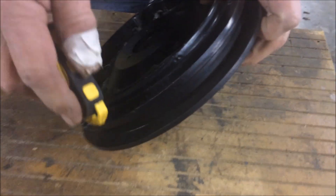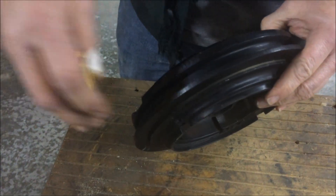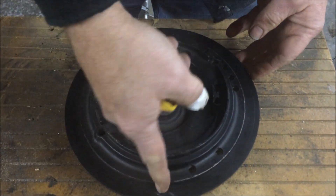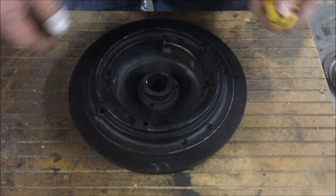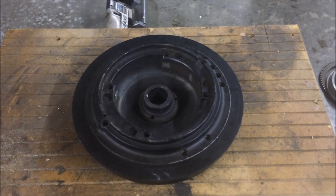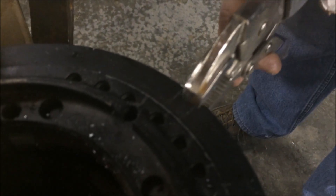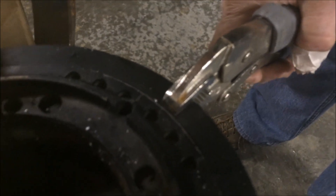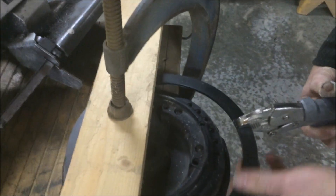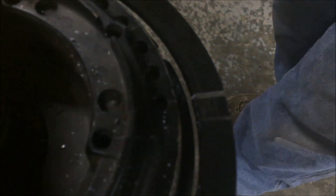This is the 1992 flywheel — you can see it's aluminum but it's got a steel ring right where the ring gear would be for the starter. We need to heat it up and knock it off, but in this case it's no good anyway, so I just put two cuts in it wide enough for a vise grip and bent it off. It busted and came right off — easy way to get that one off.